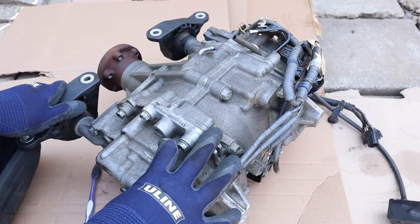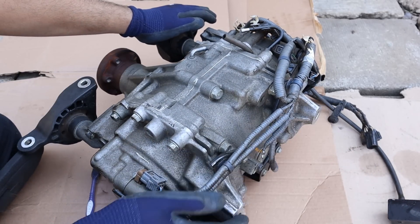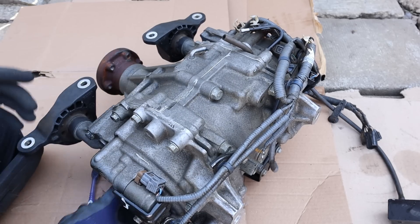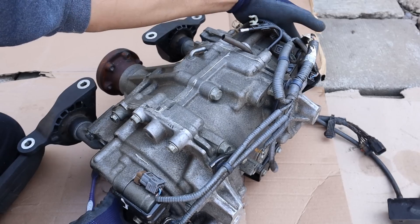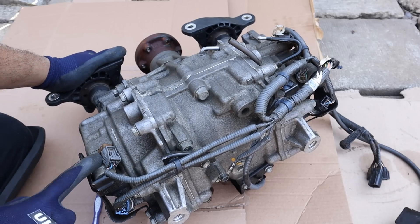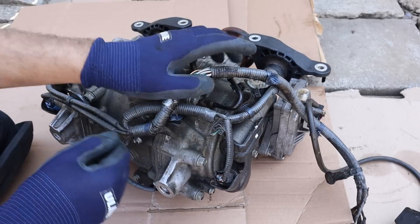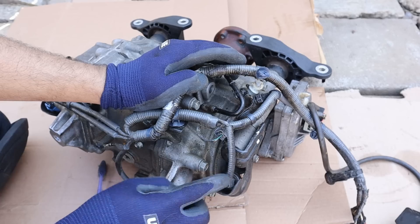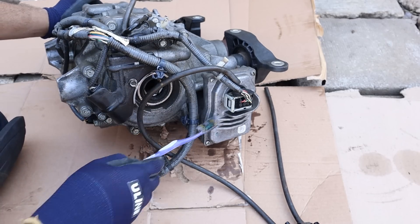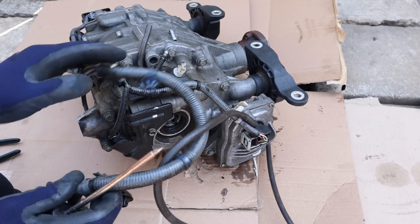Taking a quick look around this differential, you'll see that we've got these two mounts at the front and two points that mount it to the back subframe. Here is the input shaft, which is the pinion. The axles would go in here on the left side and on the right side. At the top of the differential we have the vent tube. On the left side we've got an oil control valve and a pressure switch, and then on the right side you also have what looks like an oil control valve and a pressure switch. But on the side here is where some of the magic happens — it looks like you've got an electric motor or a pump. So we're going to take this thing completely apart to see what's inside and how it works.